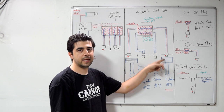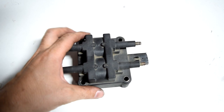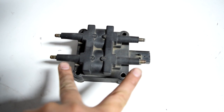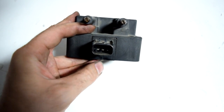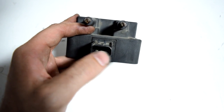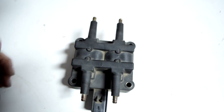In so many words, one spark is going to be wasted. Here's an example of a shared ignition coil pack from a Chrysler PT Cruiser. As you can see, we've got one coil here controlling two spark plugs and another one controlling two more. We're going to have a three-wire connector where the center one supplies the 12 volts, and then you're going to have two switching wires — one for each coil on this coil pack.